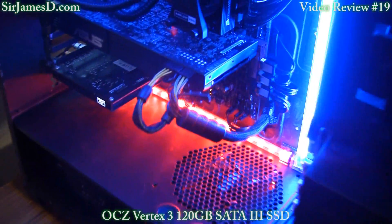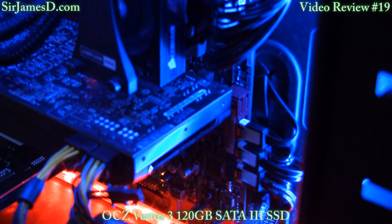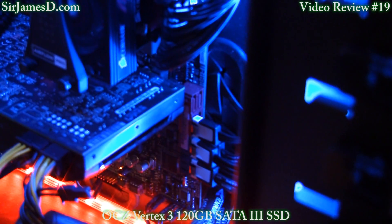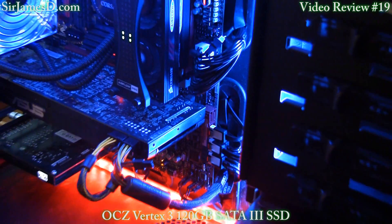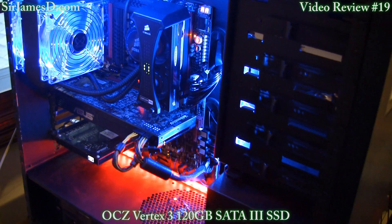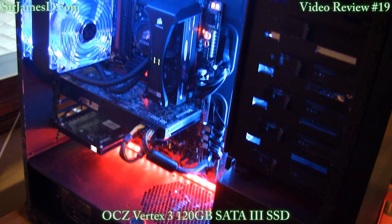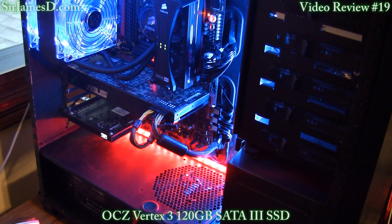Another thing to mention — check your board manufacturer's specs — but for the Maximus IV, the two red ports are controlled by the P67, so those are Intel. The others are controlled by Marvell, and the Marvell-controlled SATA 3 ports — don't even waste your time on them. It's a waste of your solid state drive's resources, they're not as fast, and the performance results are so ridiculous I'm not even going to post them. By all means, use your Intel P67-controlled SATA 6 gigabit per second ports.